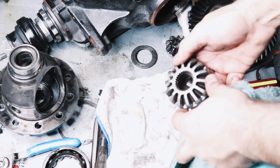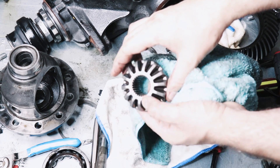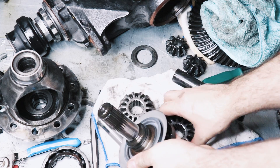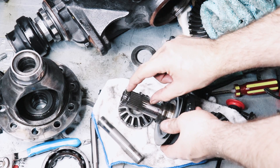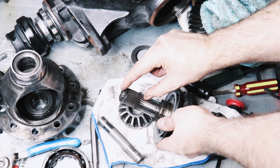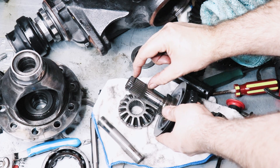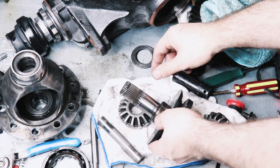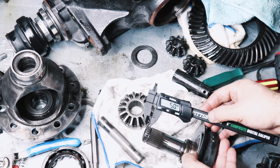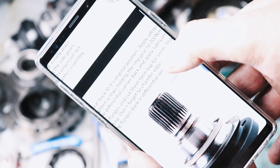As you can see, this is the surface that needs to be ground down by 2.45mm. This part here is your axle flange — this has to be trimmed down by 5mm and it has to be beveled after, like this, so you'll be able to insert it easily. You want to get that 45-degree angle and you want to reduce the length by 5mm. According to the instructions, 5mm — I'll have it end right about there.